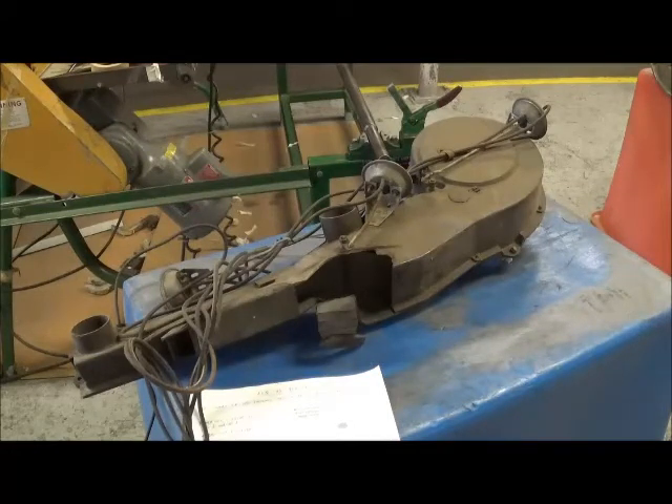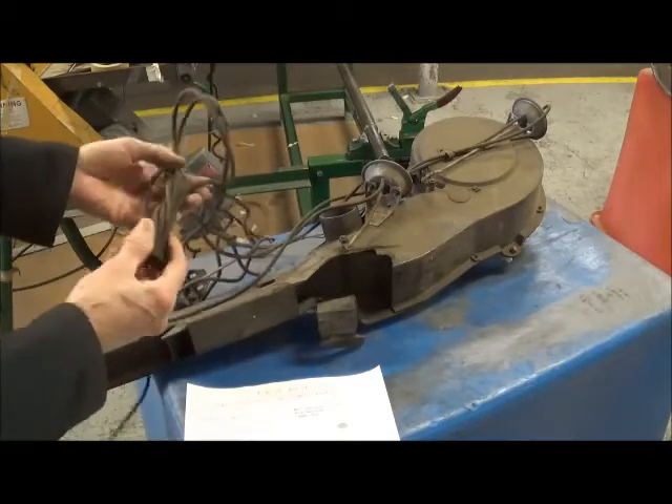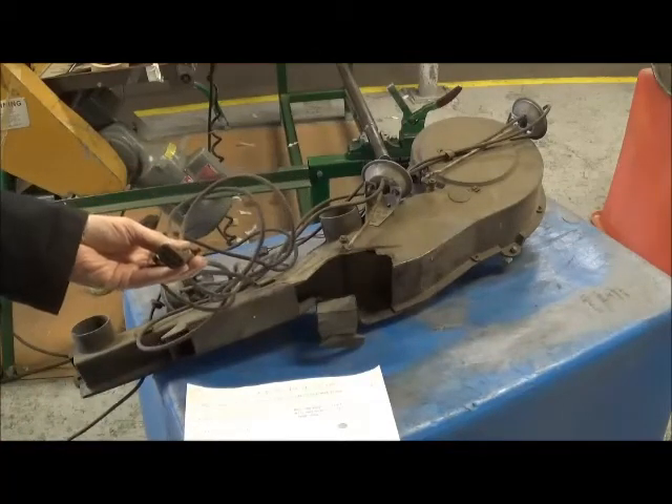Jeanine Charard, up in New Brunswick, has made up a diagram which explains the vacuum hose routing that was used on the Chrysler heater assemblies. This one we're talking about is the non-air-conditioned, and if you were to have a parts car and pull out the heater assembly, you'd have what I have sitting in front of us. There are three vacuum motors, so this tangle of vacuum hoses — and there's seven of them — you'd think it was fairly complicated.